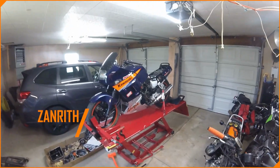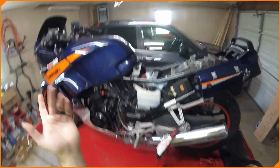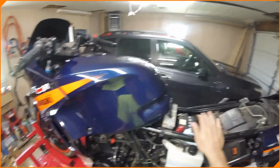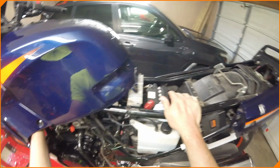That just happened. Buddy just found this Ninja 250, 2005. $500. Doesn't run. Turns over nicely. It's got compression, we can hear it, though we can't test for the compression. No fuel getting in. Says it has spark. We're going to check that.